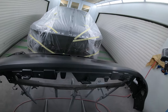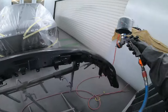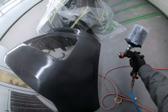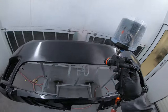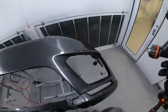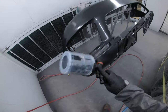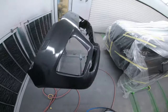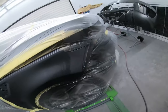It's the same thing — light coat first, then come back over it with a slightly wetter coat. We do it all in one hit with Standox. This is a light coat followed by a wetter coat, and you're ensuring before you let it dry that it's uniform. If it looks good while it's wet it'll dry nice, but if it looks patchy while it's wet it will dry patchy. This Standox is similar to Spies Hecker if anybody's used that before. I'm making sure I've got all these edges — this is already essentially a rework because of the poor colour match. I don't want to have to go back in to fix a bust-through and paint the bumper for a third time. Just get in all your edges.